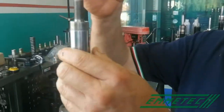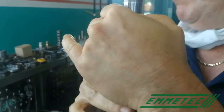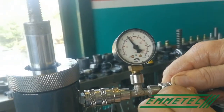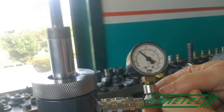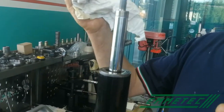We pressurize the shock absorber: insert the manometer, connect to the nitrogen, and pressurize. The rod will come up. Regulate the pressure to the wished value. We suggest an inner pressure of 4-5 bars. More is not needed. Then remove the injector. At this point you can test the shock absorber. If it works, you can remove the solenoid and put the final one with the circlip.